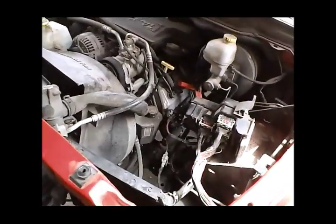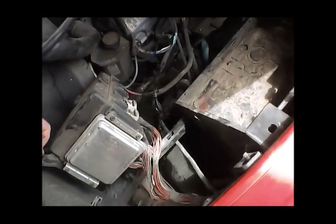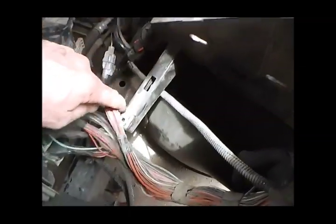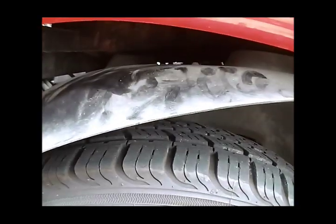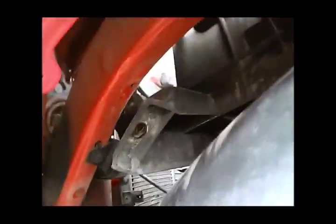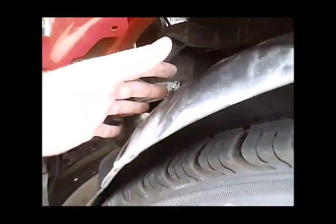It looks a little crazy right now, but if you have a Dodge and you work on it, you might find some of this stuff familiar. The whole problem with getting the fan out is this bracket right here. This is the battery box, and it's up and out of the way nicely for me right now because of this repair. The battery box attaches here, then the fuse panel attaches to the battery box. You have to remove that. To remove the battery box, you've got the main basic bolts right up on top, and then you have to remove the bolts holding the wheel well plastic guard — there are two more bolts, one here and one here.